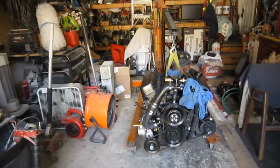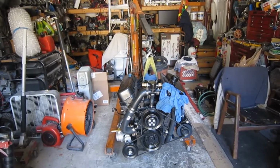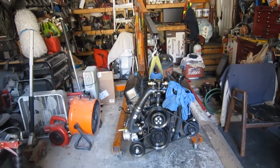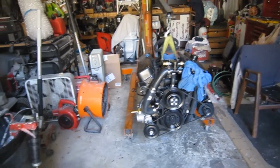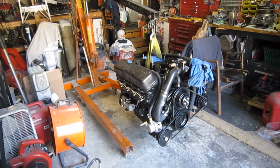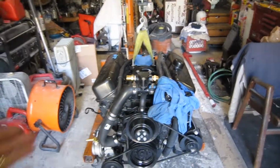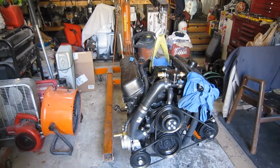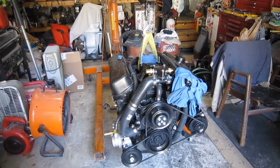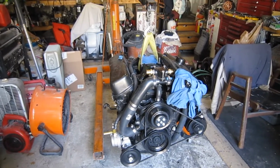So as I said, everything's been pulled out. A couple minor boxes just need to get pushed out of the way as we go, and this big boy is going in that boat for a second time. I will say that I have my fingers crossed that it's the final time, but I'm not going to swear to it, because every time you get kind of matter of fact about things, there's always something that can go wrong. I had a full day yesterday of fixing everything up, from moving the alternator over to straightening out the fan belts and changing motor mounts, and then we spent a couple days rebuilding motor mounts. We've had a week worth of work here just to make it a second attempt. So our fingers are crossed, but like I said, if it goes south, we'll just have to deal then.